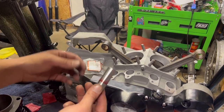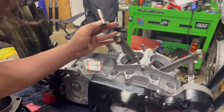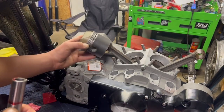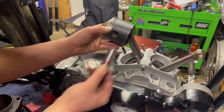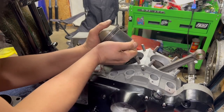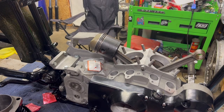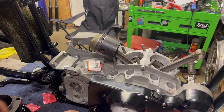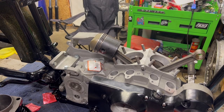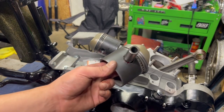Snap rings are in on one side. Got some assembly lube on this connecting rod — put a little bit more in here. Wrist pin is lubed up. Spiral clip is on this side of the piston, going on the primary side. Line these up roughly in the wrist pin bore, and just like that, that's how that's supposed to go. Now that we put the snap rings in first, the wrist pin will bottom out on the other side. Let me work this wrist pin in — it worked fine once I had everything lubed up. I'll do that off camera since I just did that on the last one.